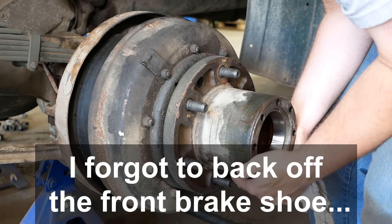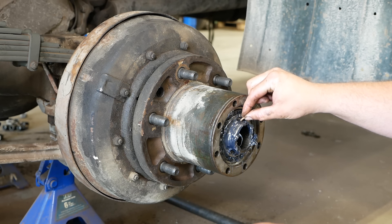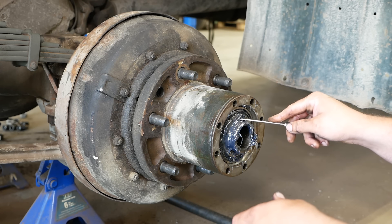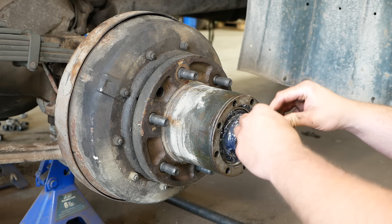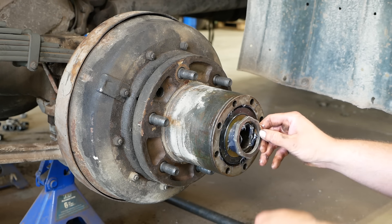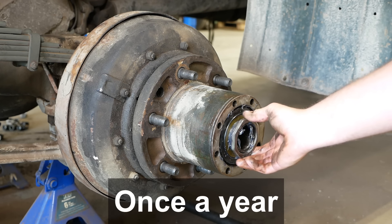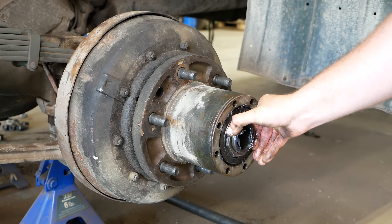The book shows there's a little cork wedge that goes in the keyway underneath the bearing. But the Memphis Equipment guy didn't seem to really know what I was talking about — apparently it's not a common part or maybe it's been discontinued. I just cut some strips of cork gasket material and we're going to stick those in there. If you look at the way this is constructed, it has to leak — at a minimum it has to leak oil into the grease. But if you look in the book, I'm sure there's a very short service interval on these bearings, probably like 5,000 miles or less. I had a couple of buddies in college who were light vehicle mechanics in the military and they always said they spent a lot of time repacking wheel bearings, even on stuff that had basically no miles.